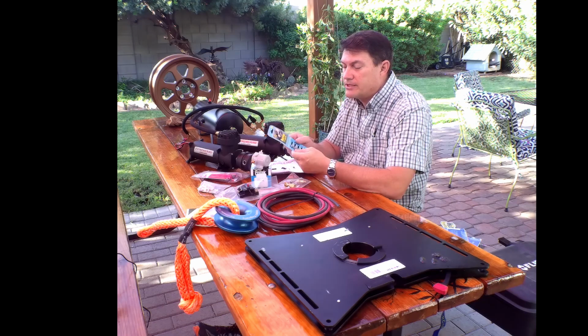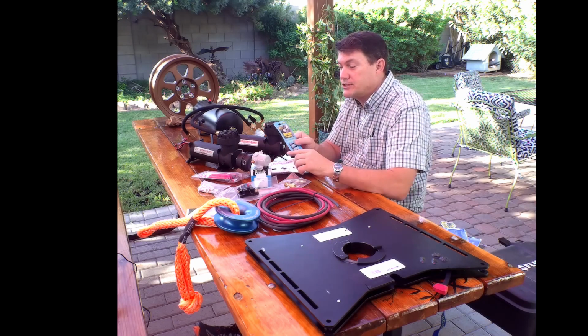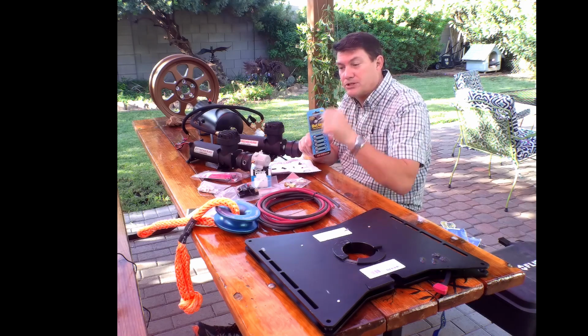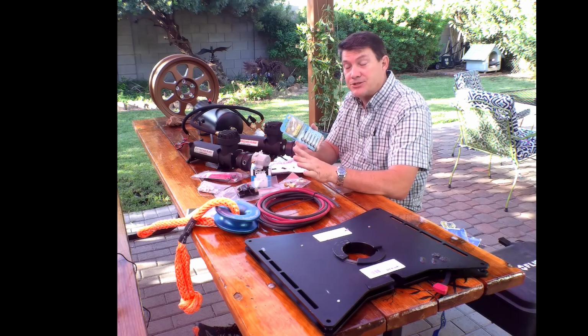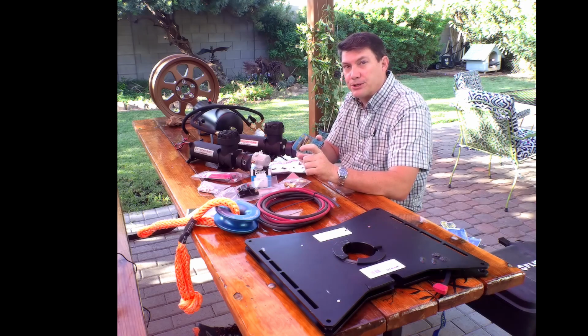What's great about these things is they actually have a little rubber O-ring seal in there. So you could take your whole valve core out and just run these. George actually will tell you when he's off-road, that's what he does. He deflates faster by pulling his valve core out, lets the air down, screws this on tight, does a whole trail. When he's done and ready to air up, he airs up faster. Your Schrader valve core actually limits the speed that your air compressor can air you up.